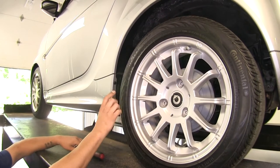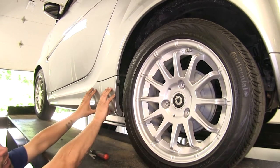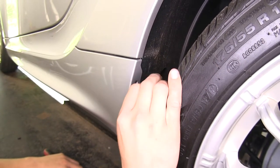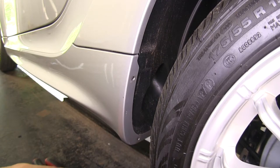At the back of our vehicle, right in front of our tire in the wheel well area, we're going to have two push pin fasteners holding the lower valance on our vehicle. We need to remove those — pop out the center section and then get the larger section behind it. Once this side is done, repeat on the other side.